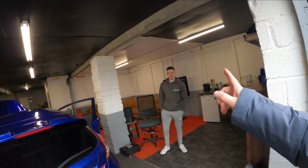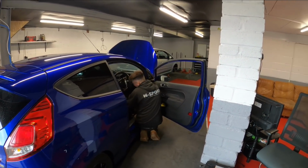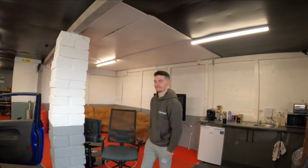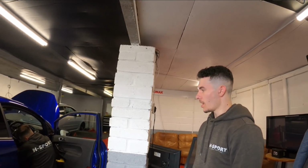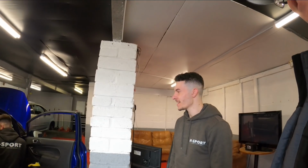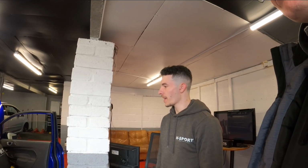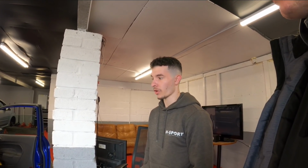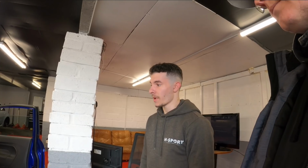Right, so the boys are just making a start. There's Connor and Jordan, already working. So what's the plan for today then, boys? So the plan is we go back to stock Ford software. From there we're going to smoke test the car, just make sure everything that you've done's all good. I'm sure everything's all good, but we just check it just to make sure. And then from there we send the file off to Peter. Peter then modifies the file to basically a base file. We log that, see how the car reacts, and then from there on we just go upwards, to a stage where you're happy.